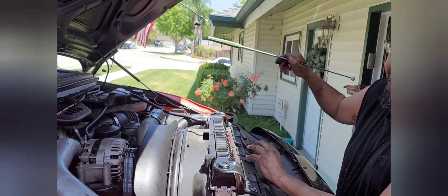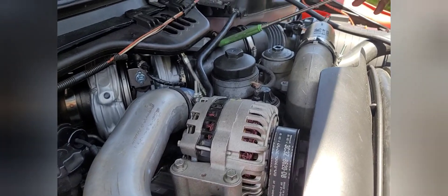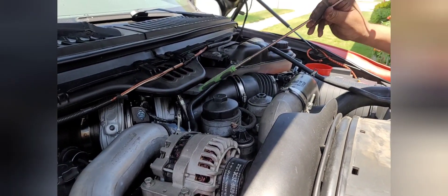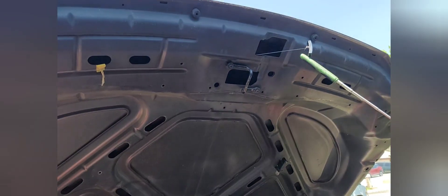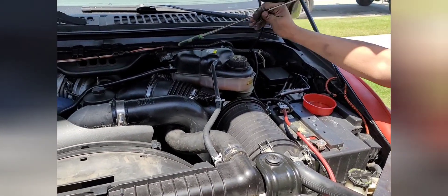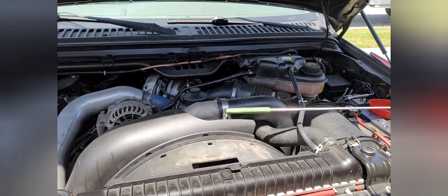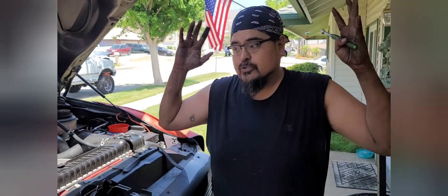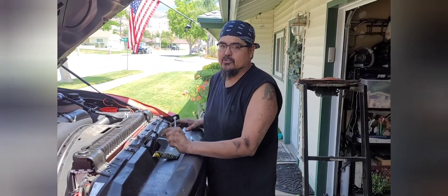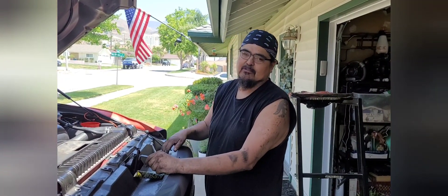The turbo is back together. The last things I did — you saw it come apart — I put the charge air cooler boot back on with an 11mm clamp on each side, put the ducting to the air filter back on with an 8mm here and an 8mm here, got your mass airflow sensor, still need to put the oil filter cap in and probably get a new dipstick — you can see where it's broken. Get your degas bottle line back up with a couple of 8mms, put all your clips and harness back on. That's the video! I hope you guys enjoyed it — that's how Power Stroke Jude R&Rs a turbo. Please remember to like, comment, share, subscribe, and ring that bell. Until next time — keep on keeping on, Power Stroke Jude out.